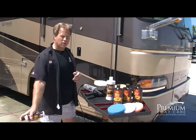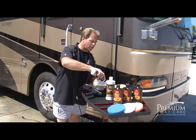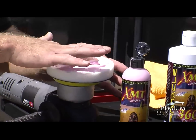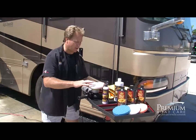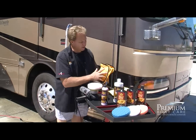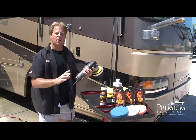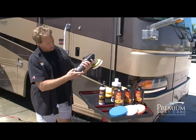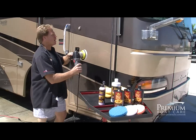When you start out, always shake your product up. I've got a clean dry pad here. I'm going to put some product onto the pad and push it in — this is called priming the pad. That way, when you turn the polisher on, you're not bringing a dry rotating pad right against the paint. Spread that out with your finger and wipe any excess off. These are variable speed tools — they start at zero and go to six. For applying a one-step cleaner wax, around the five setting is pretty good. Don't turn it on until it's against the paint, then make slow overlapping passes.